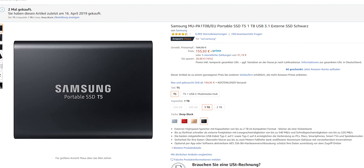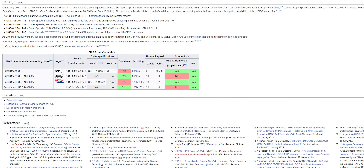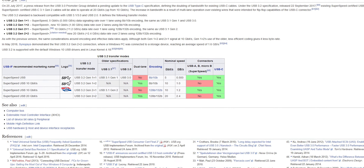If you look at probably the most popular external SSD you can find at the moment, it's the Samsung T5 — probably the most affordable and one of the best external SATA SSDs available. SATA SSD means we are looking at USB 3.2 Gen 1, around 5 gigabits a second, which translates to about 550 to 580 megabytes a second sequential reads and writes.